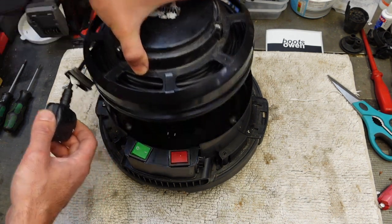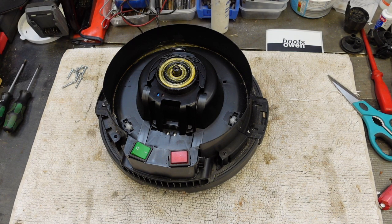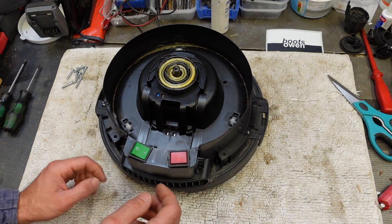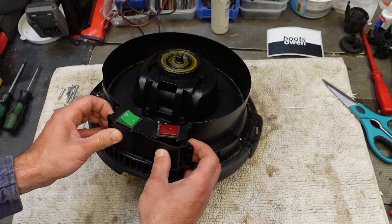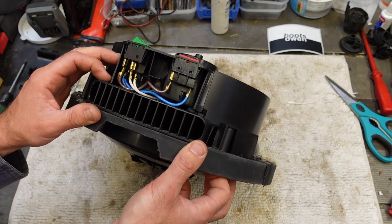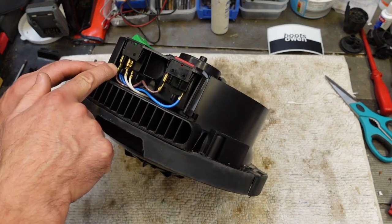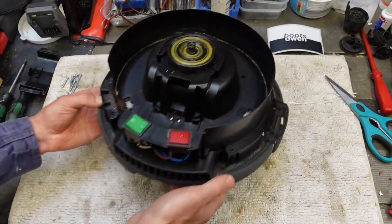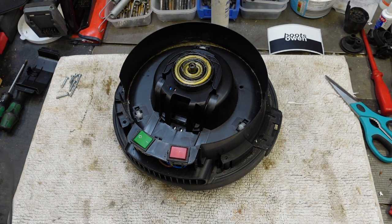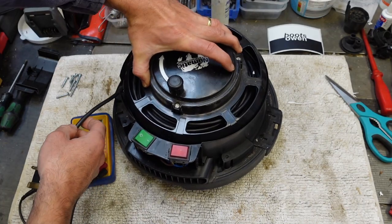While I'm here, I'll lift this one away. We know that power was getting through the cord because the light was on. So because that light came on, we know the power is getting in as far as here. So we can snap this fellow off now. This is quite a clean machine. So that's the live side - it's not live at the moment. So what I'll do is plug it in and test it with the multimeter to see if the switch is working. And if it's not the switch, it's the motor.